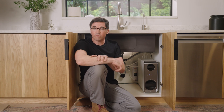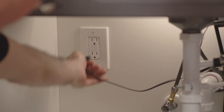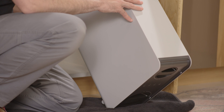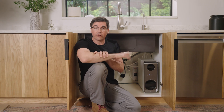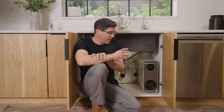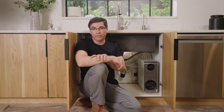If you're seeing the status lights on the front of the unit blink red, this indicates that a little bit of water may be sitting in the bottom of the unit that we need to clear out. To do this, unplug the unit from the wall and then tilt it forward or backward to a 45-degree angle, letting it sit for about 30 seconds to allow that water to run out. If you have enough slack and clearance in your install location, you can do that in place. However, you may need to make a couple disconnections to pull the unit out far enough to achieve that angle.